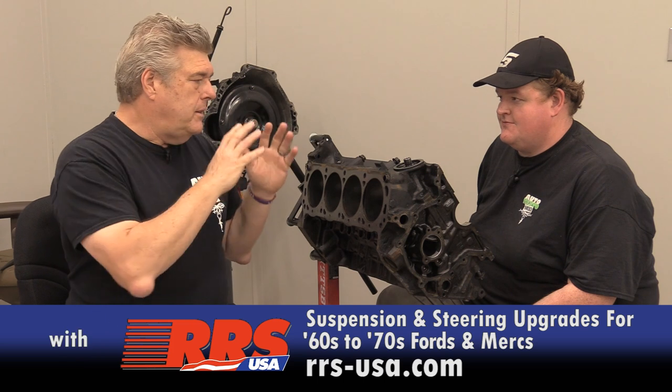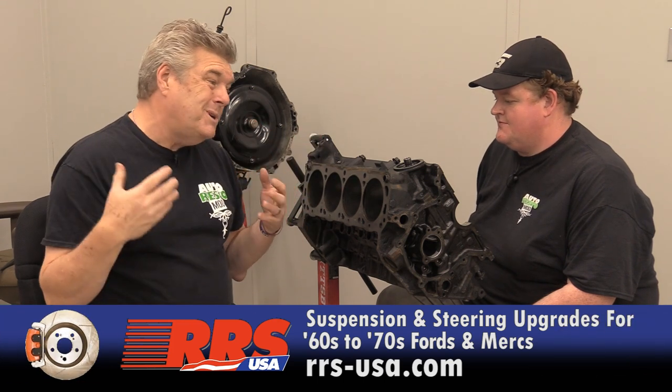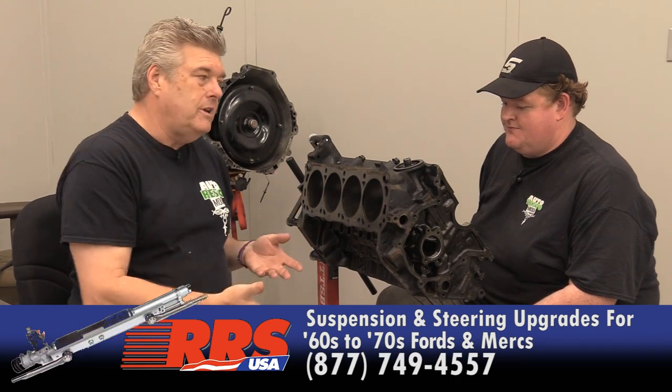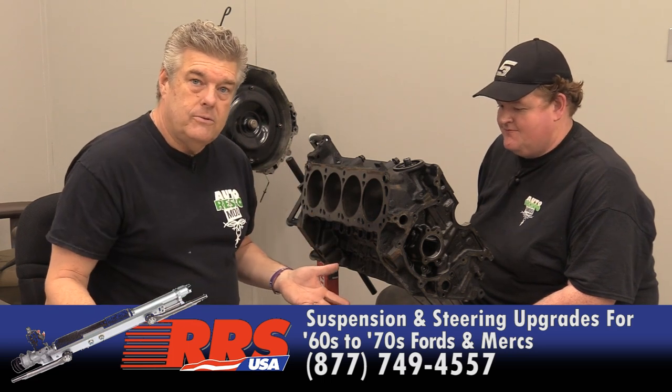I understand what you guys were saying when you suggested maybe ARP rod bolts. We are going to be replacing the main bolts and the head bolts. We are going to take that level of caution, but we're not going to be putting ARP in there because it is more expensive than the Dorman products that you can get, and at this power level, that's really all you need.